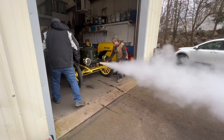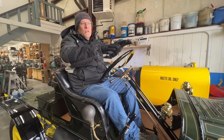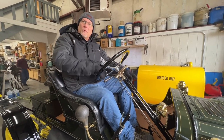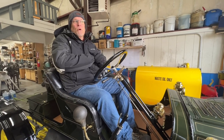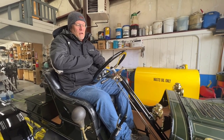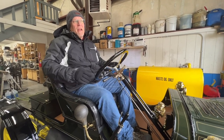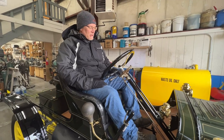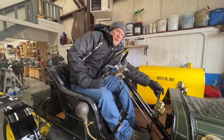This car has four taps off the bottom of the boiler that blow it down from four quadrants. One of them is also connected to the reflex water level gauge, so that gets blown down during this process too. Blowing down is kind of dramatic — it's fun at the end of the day, and it usually impresses all the spectators when you come back from a tour and blow the car down.